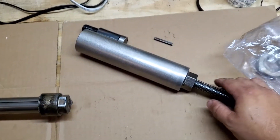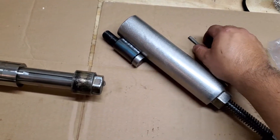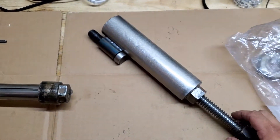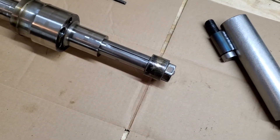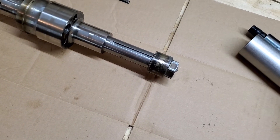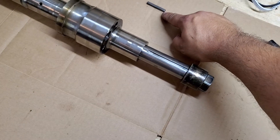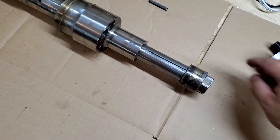I got this eccentric shaft puller from Pineapple Racing. It's nothing crazy — it has a keyway for the hub. You want to make sure you grease the inside and grease that nut before you put this in there, so you don't mess up the stainless steel nut. Then just slide this right over. The keyway is the only thing that keeps this lined up where it needs to be.